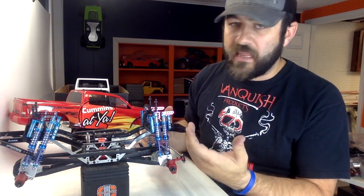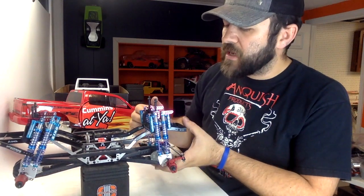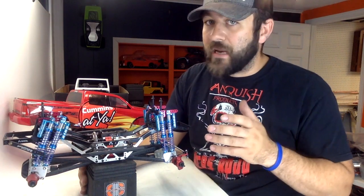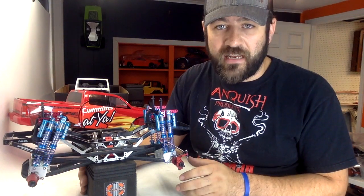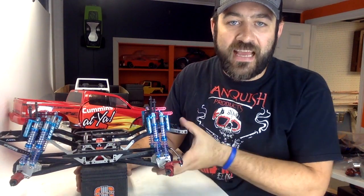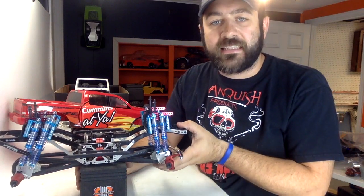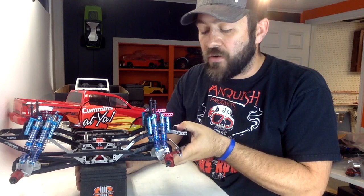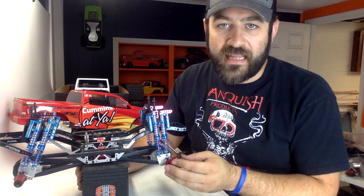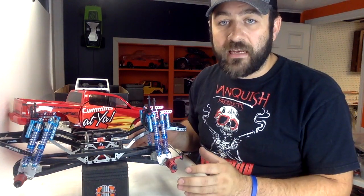I did play around with the fronts as far as standing them up more or less, putting them behind the shock tower up front, and ended up about where I've got them here — pretty happy with that. In general I think this setup is going to work out pretty well. This truck will have a stiff suspension, but I'm totally fine with that. Flex for a truck like this is not something I'm interested in at all. Now that I have the King shocks installed all the way around, I can move on to installing that RC Four Wheel Drive front bumper setup. I wanted to get the shocks installed first so I could see exactly how much this front axle was going to travel and how things were moving around before mounting that front bumper and trimming the body.